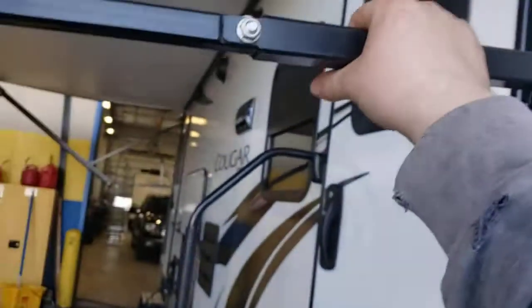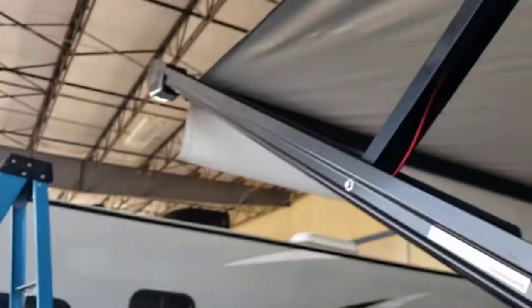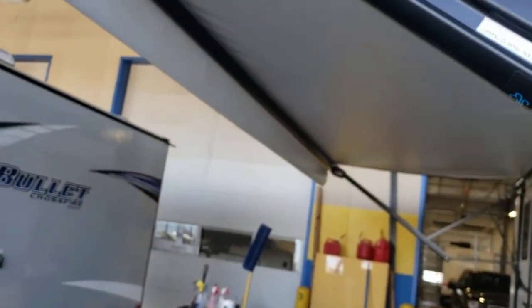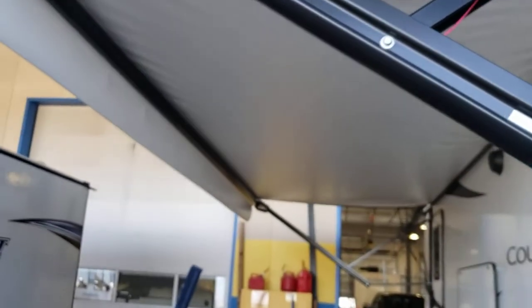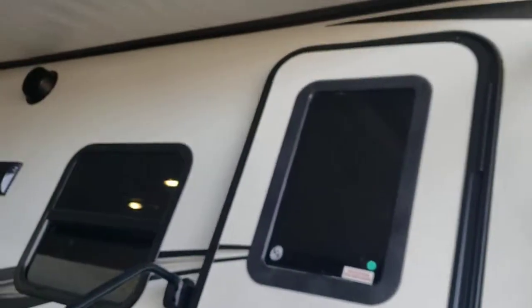Your awning is controlled in two different ways. You can grab right here, pull it down, and pitch one end lower — so if it's raining, water runs off in one corner rather than all along the edge. If it starts really storming, roll your awning in to keep the wind from ripping it off. If you roll it in wet, roll it back out as soon as you can to let it dry. The awnings are prepped for wind sensors but don't have them installed — if you want one, we can install it, and it will automatically roll the awning up when gusts are detected.